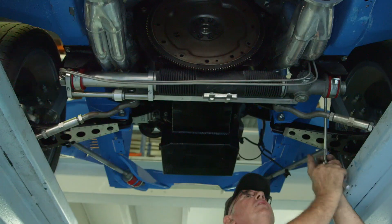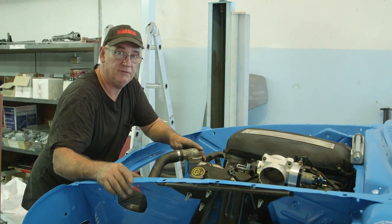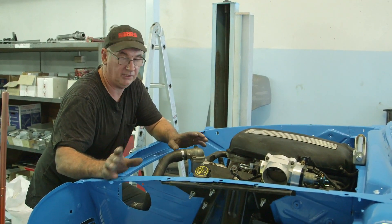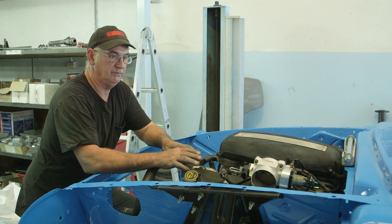This particular swap is using a 5.4 32-valve quad-cam Boss motor and a ZF six-speed auto. I always recommend the engine and transmission be fitted prior to setting up the three-link. Setting up drivetrain angle is absolutely vital. A big problem I see is when people put a manual five- or six-speed transmission without modifying the tunnel — they drop the back of the motor right down and end up with a five-degree or more engine drivetrain angle, causing tail shaft vibration or limited life on universal joints.